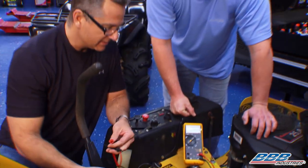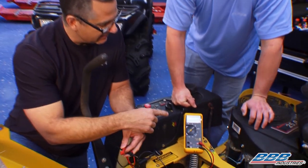Then we can go one step further — down to the solenoid and check for voltage drops. Voltage drops are a good way to check for any resistance. Maybe you have a loose cable, bad cables, frayed cables, whatever it may be.